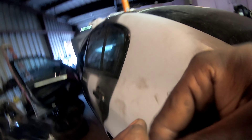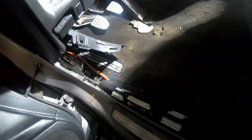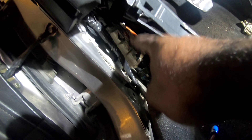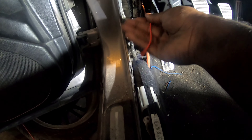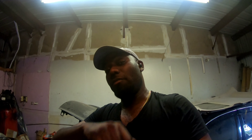This fuse tap is for the big fuse, that's why I can't fully show you right now. But you run it through your car and then you tap it into one of the fuses - I'm gonna tap it into the cigarette lighter fuse. So basically you put the existing fuse on top, you put the fuse tap for the starlight right here and it goes like that, and this connects to the wire you're gonna connect to the positive. Good luck guys - I gotta go buy one of these. Pretty much it's done, man. It took me a while, it's time consuming but it's worth it. Like, comment, and subscribe - if you got any questions hit me up. If you don't want to do it yourself, holler at me, but it's gonna cost you. Let's get it, man.